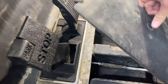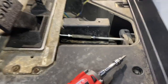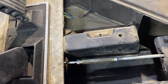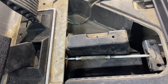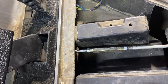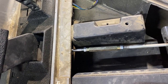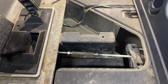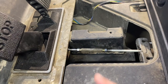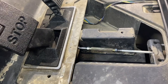To open the brake access panel, just pull it up — there's a little plastic Christmas tree on the back that retains it. In here it's going to be really dirty, so this is a great time to take a shop vac and suck all that out. This brake rod looks brand new because a few weeks ago that bolt was very rusted and corroded, so I replaced it. While you're installing this kit, I'd take the time to clean this out and spray all the springs underneath with WD-40 to try to prolong their life.